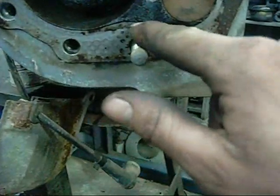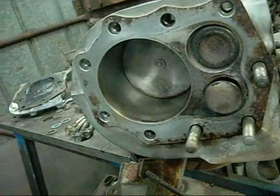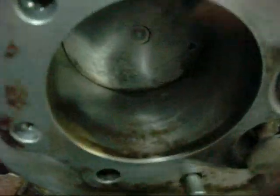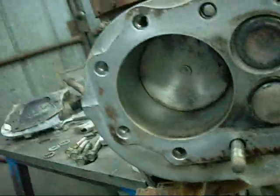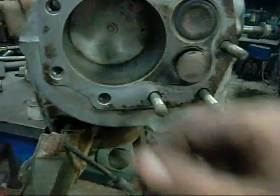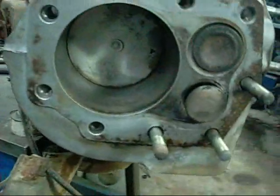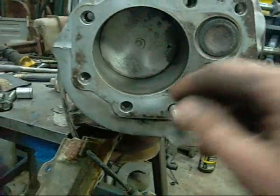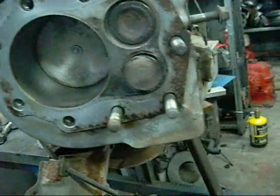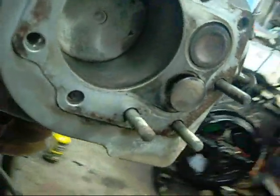Looks like it's maintained its seal — the head gasket has been holding out fine. That's looking a bit better already. I haven't touched the valve yet, but I just thought I'd look at the bore and see what it came up like, and it's just fine. Like an old motorcycle guru I know told me: unless you've got major dollars invested in the engine, don't be afraid to take a bit of emery cloth and oil and just clean that sucker up if it's glazed or damaged. You don't have to hone it, you don't have to worry about taking the piston out — just blow all the crap out, clean it all up and see how she goes. Once it's running properly it'll blow all the remaining oil and dirt out the exhaust anyway. Hell, you've got nothing else to lose.